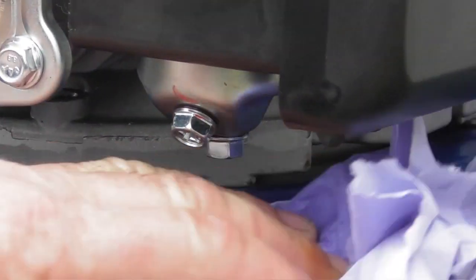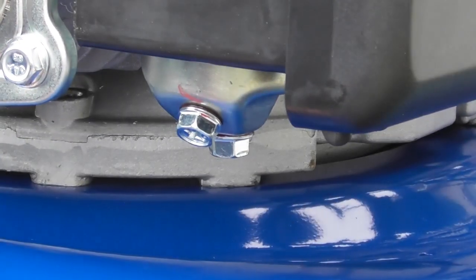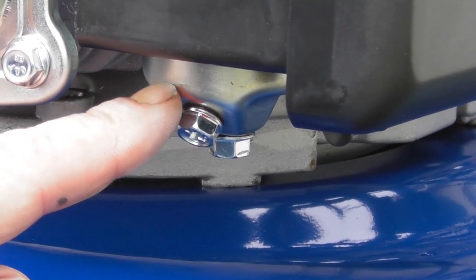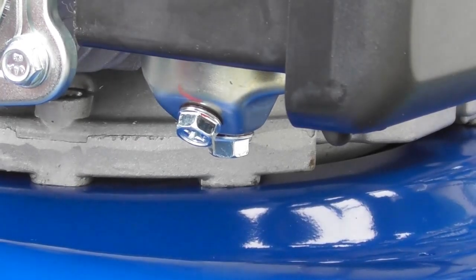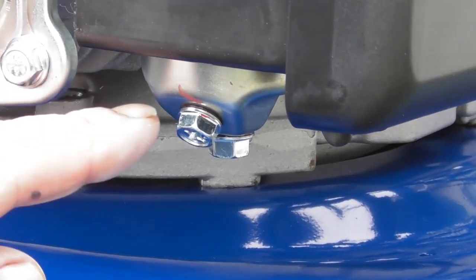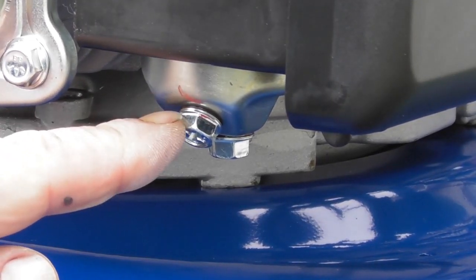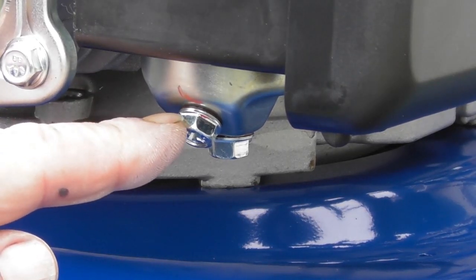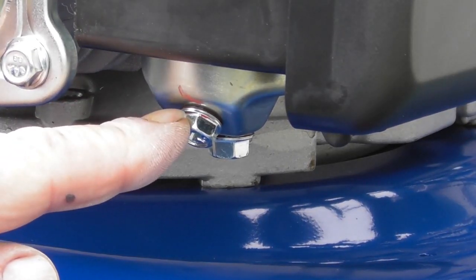There are some fuel-soaked rags — they will evaporate off quite carefully, but bear in mind that these will be highly flammable as well. That should have drained any stale fuel if it were only in the carburetor. If it hasn't been in there too long and the fuel in the tank still smells okay, there's a good possibility the lawnmower may now start. That's the first scenario. Let's go on to a worst case scenario where all the fuel in the tank is stale and it's stale in the carburetor as well.